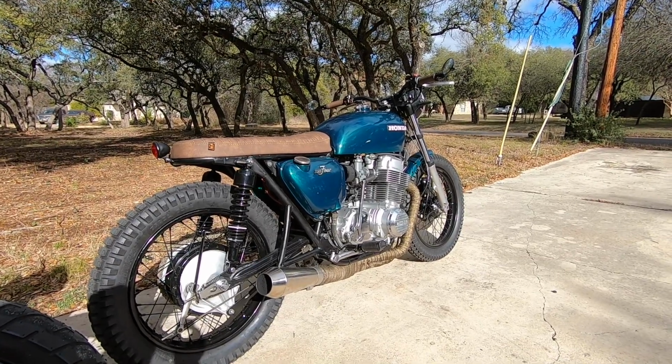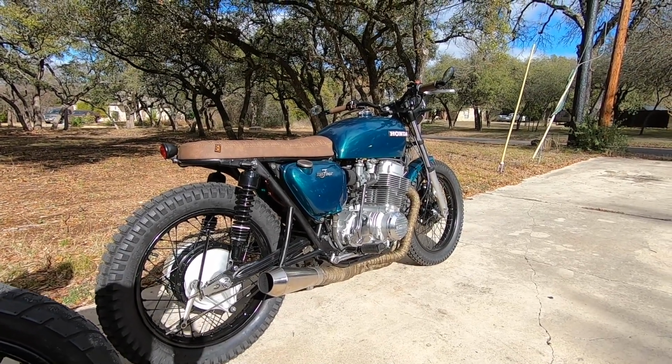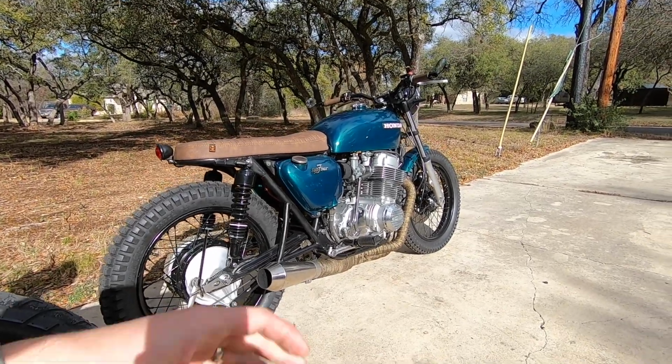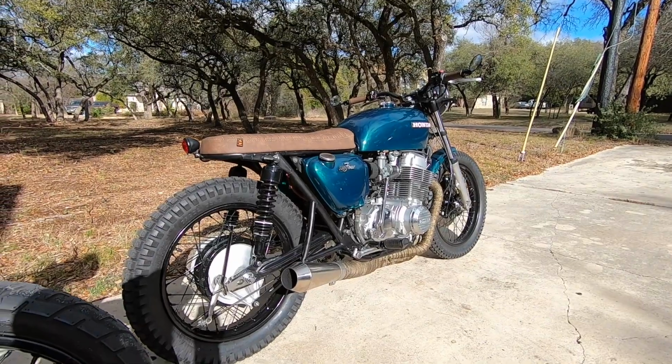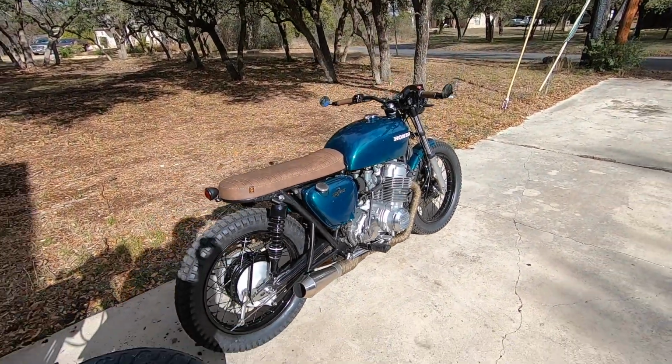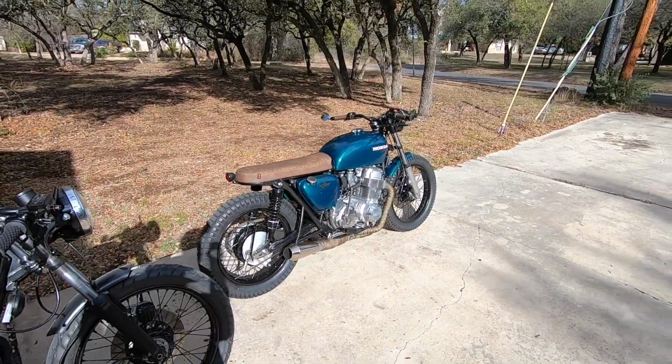But since it is a customer bike, I wanted to go ahead and take the whole top end apart, make 100% sure it wasn't a broken ring or anything too serious. All new gaskets and seals all the way up, just for peace of mind that they're not going to have any issues. Now it's got great compression across all 4. Bike runs really well, actually.